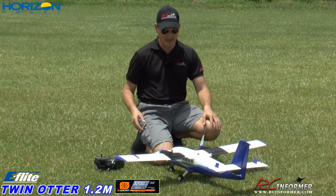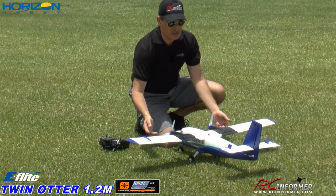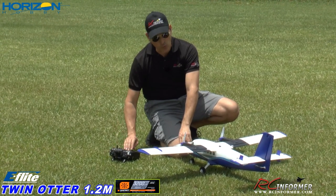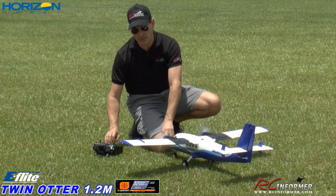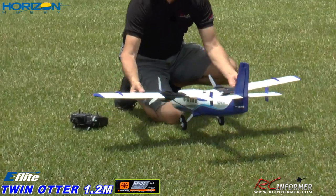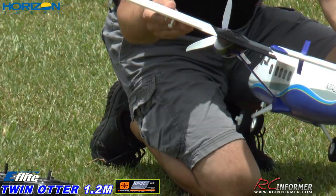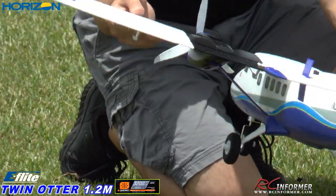It's not active yet. As you move the controls, it's not offering any correction at all until you come up to about a quarter throttle. I'll take my safety off, we'll add a little more than a quarter, and you can see now — Steve, if you can get on one of these ailerons — it's now correcting. The aileron's correcting in the direction. Pitch and roll, they're all correcting.